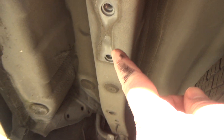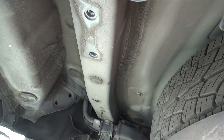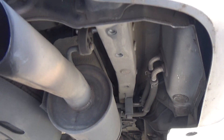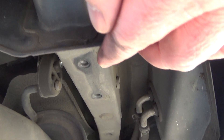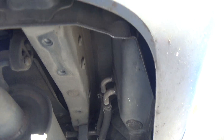This is what it's going to look like, and I got to do that to the other side. The bolts that are going to go in — already checked and they're 17 millimeter. I just finished it up, this isn't rocket science. That plug comes off really easy. If you didn't have a special tool like that, you could probably use a flathead screwdriver. Then take out the two bolts there. I'll find out hopefully that matches up with these two and that one. There is another plug in the middle but I guess that just gets covered up — we'll find out.